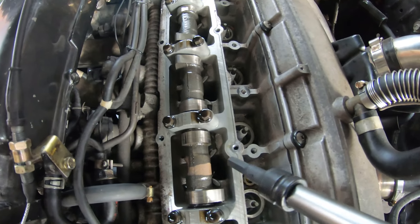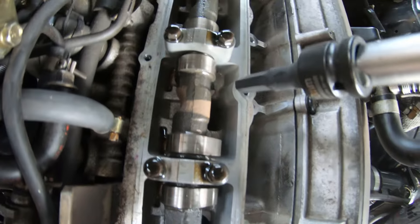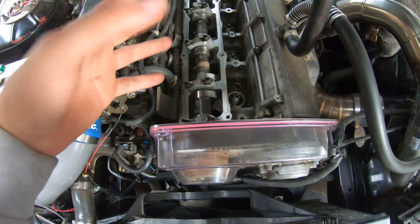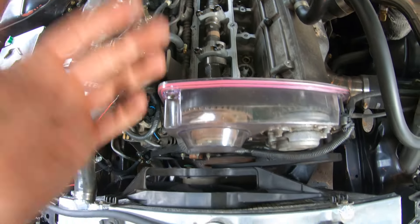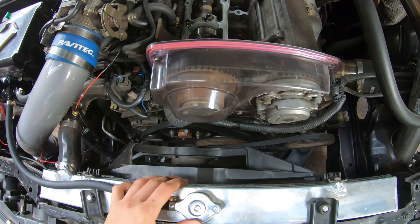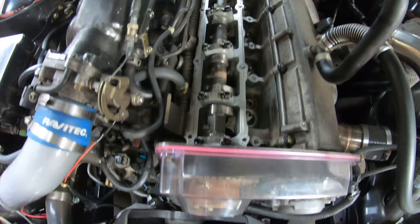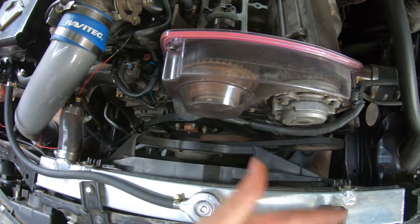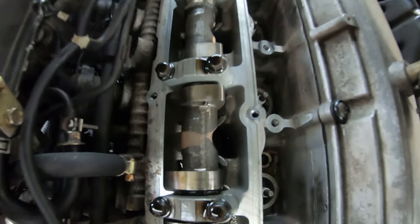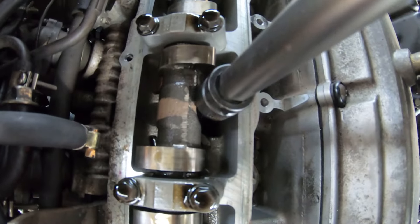This tool wouldn't fit in there - it hits up against the camshaft. Even if it was at top dead center, that groove still wouldn't be enough to fit this tool in. I remember doing it on my 33 - I forgot about the camshafts. You have to take them off to get to the head studs. That means we're going to have to take out all of this, and I hate doing that because it's so time consuming. We might as well drain the oil too. I've put everything at top dead center so you can see we've made more room for the stock head stud, but the tool still does not fit because it hits up against the camshaft.